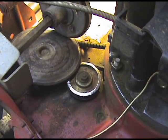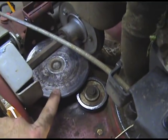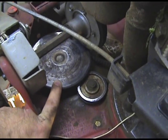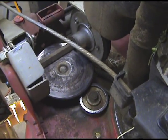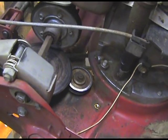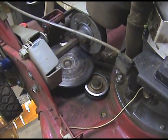I'm going to see if this does the trick for today and take a quick look to see if I can get that disc more stable. There was a 9/16ths nut on the bottom side of this disc — I just tightened it up a couple of turns and boom, it leveled right out. The pulley is clearing perfectly, so I think that's going to help a lot. This thing should work perfectly when we get the new belt. I'm going to put the chute back on and give it a test to see if it drives without breaking the belt.